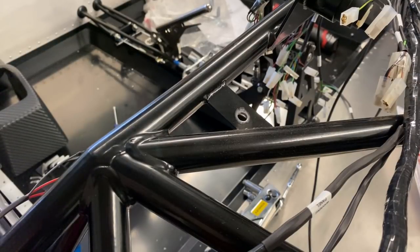That's pretty much it. The other thing you can do is, if it is in a situation where it's going to potentially cop a bit of corrosion, just hit it with a bit of dielectric grease, and that'll ensure that it doesn't develop a high resistance over time.